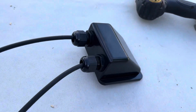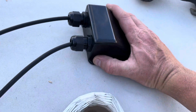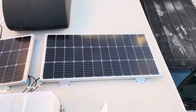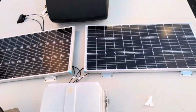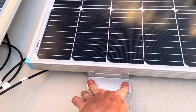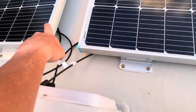And slap this back down on the butyl tape, and then re-epoxy, self-level epoxy around this as well. So have it all gooped up nice. I got these laid out. I decided to do them this way since the roof's kind of curved. I'd get a little that way, a little that way, whatever. Got the butyl tape under here on the screws. And I'm not going to hook this up just yet, so I just tucked these up in here. The other ones coming out are underneath there.